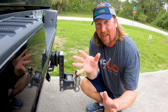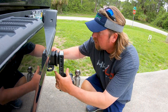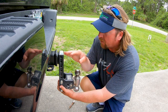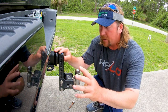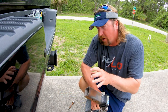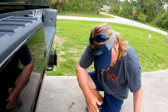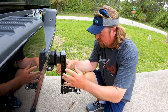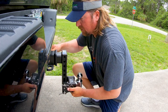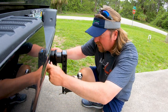Now this is how easy this is going to be to change. All you've got to do — I've got a locking mechanism on my pin that connects to the truck. Pull it out just like that. Your pin comes out, and here's what I was talking about with the B&W coming with the 2-1/2-inch receiver. You can order them with 2-inch too, but with me having a 3/4-ton truck, you use the 2-1/2-inch receiver. It just slides right out — there's no adapter on it, we don't have to use any kind of adapter at all. I'm taking the 7-inch drop off. It just didn't have my trailer tongue in the proper position. So we shall put the new 9-inch drop on — just like that. Put our locking pin back in, and we're done.